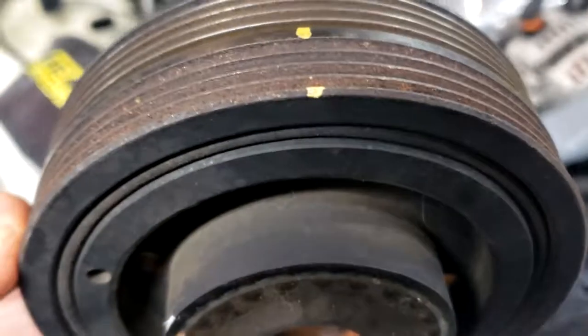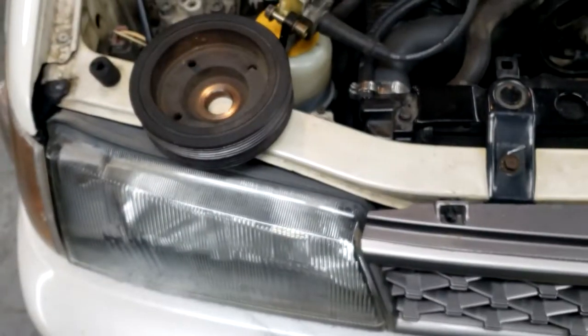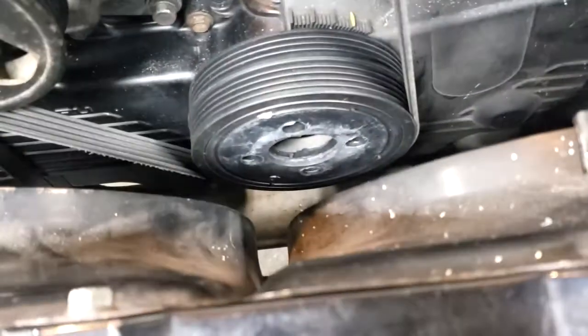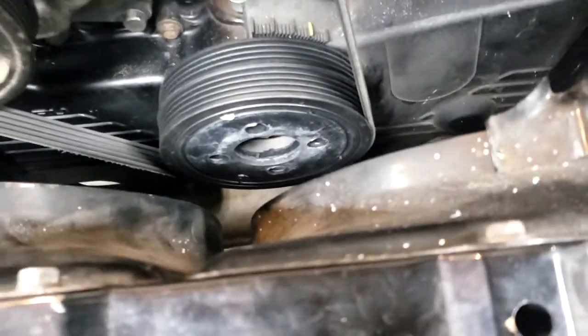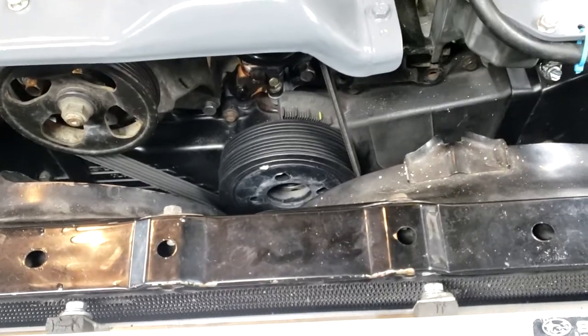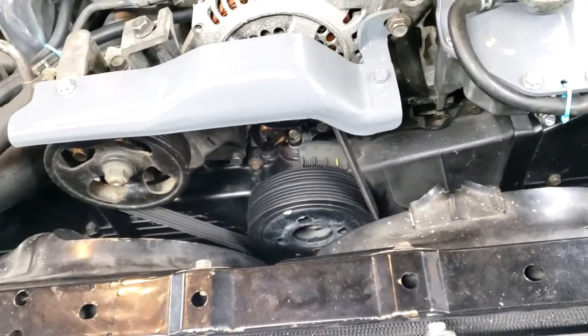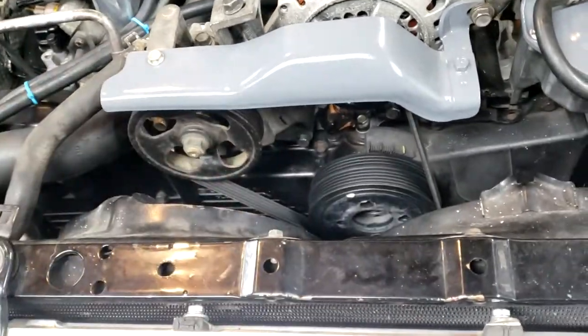We were using the correct timing mark — it's a little tiny notch on the backside of the crank pulley. I went ahead and got a new harmonic balancer because this one was wobbling on there. I bought one for an 07 WRX through NAPA, about 70 bucks through my work. It's probably not the greatest quality, but I'll keep an eye on it. I have an 06 to 13 WRX flywheel and clutch setup, so it might be a little heavier but at least it'll match the flywheel and hopefully not wobble.